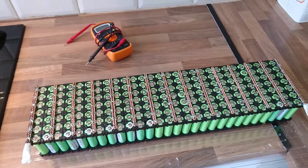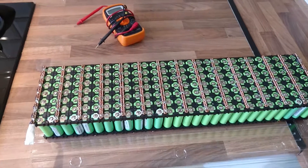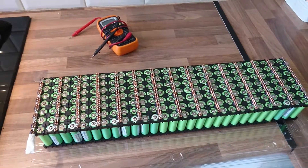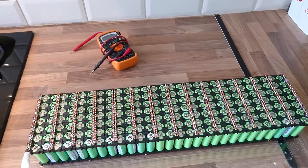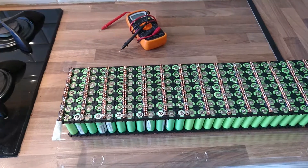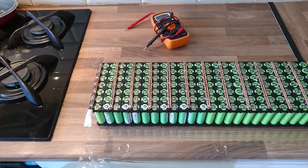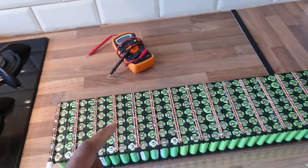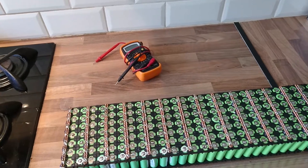Another two months it will probably show only 7 miles — it's a rubbish battery. Having this one paralleled with it will help slow the degradation. Even though it's 4.4 kilowatt-hours, you can only use 3 kilowatt-hours because they're trying to save it by not allowing you to use the remaining 1.4 kilowatt-hours. If they allowed the full 4.4, it would probably be dead by now — and the car is only 80,000 miles.